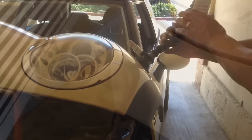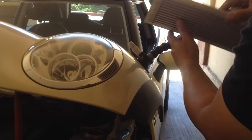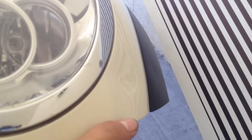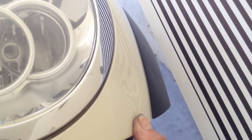The use of a line board allows me to see the contours of the dent more clearly. I use a swing arm with a suction base to position the line board. In this way, I can see in real time what's happening to the dent as I apply force to the backside. As I apply force in a particular point, I can see the lines squeeze together at that point.